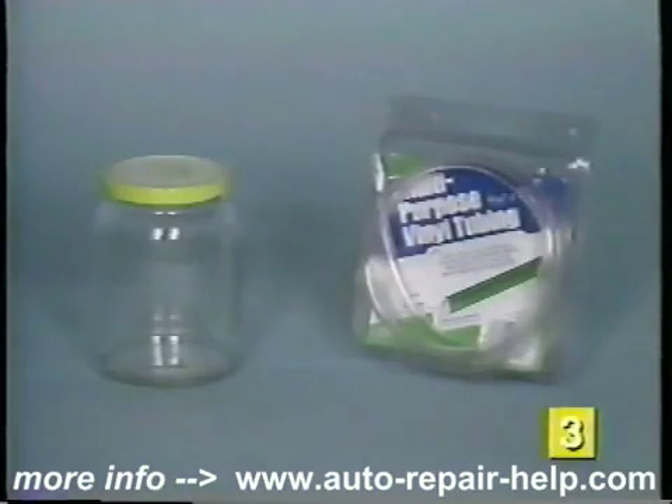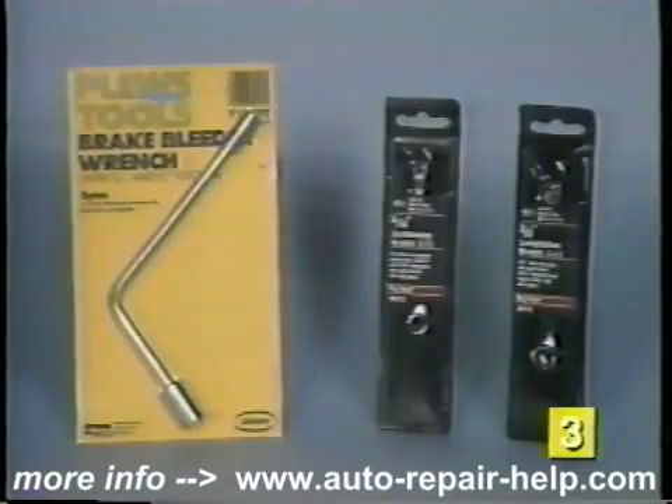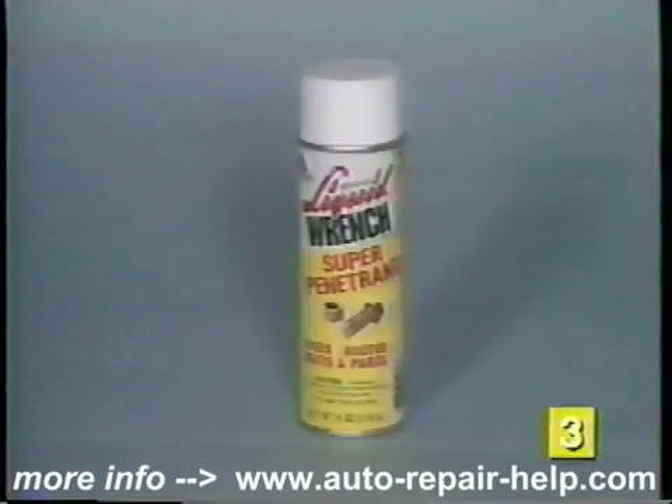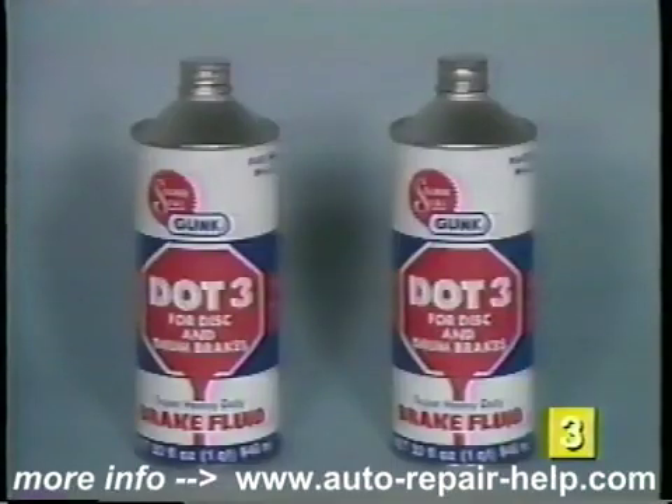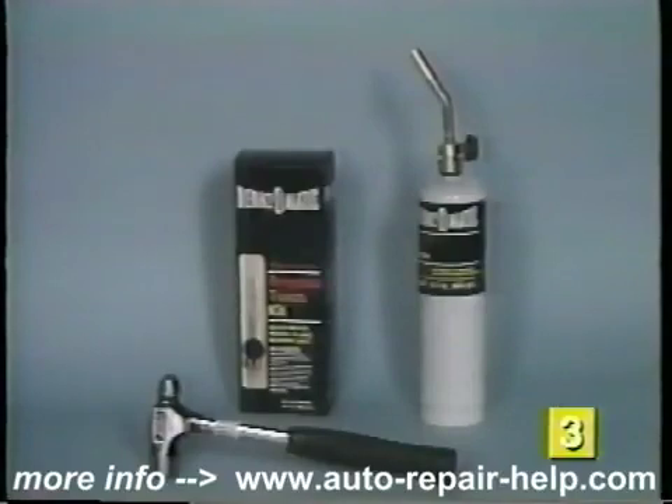The items you'll need are a piece of clear plastic hose and a clear container, a brake bleeding wrench or a couple of small six-point box end wrenches — usually about five-sixteenths of an inch or three-eighths of an inch in size — some spray penetrating oil, a pair of safety glasses, some shop towels, brake fluid up to two quarts if you're going to bleed the entire system, and in some cases a hammer and a small propane torch.